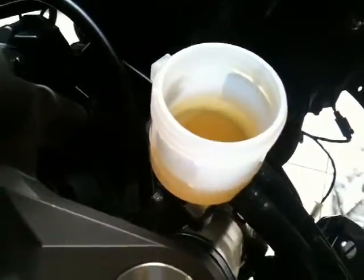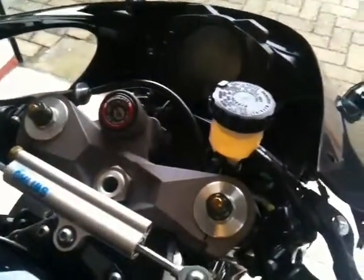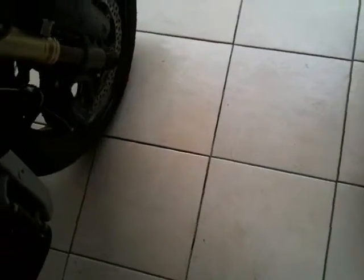And yeah, that reservoir's getting down, so I'm going to top it up again now. So, there we go. All bled off. All topped up to the right level. Fresh fluid. Brakes all pumped out, all cleaned off, and there was no more air coming out of them by the time the last few I did. You tighten off the bleed screws, all done.